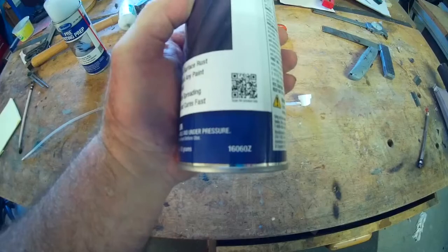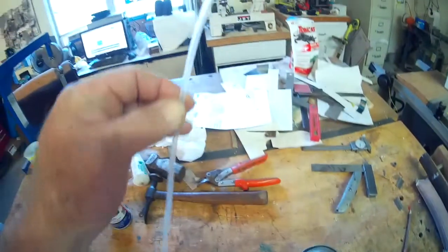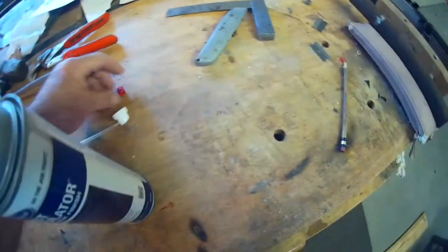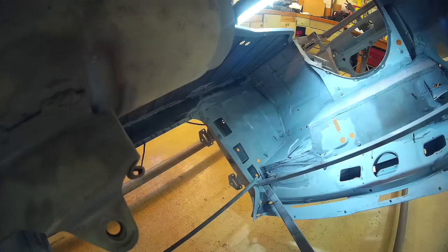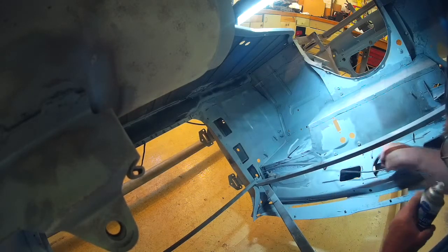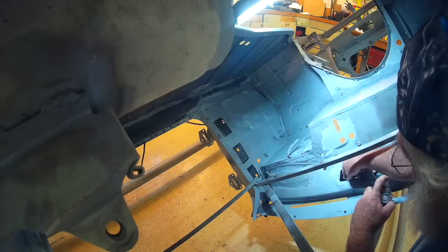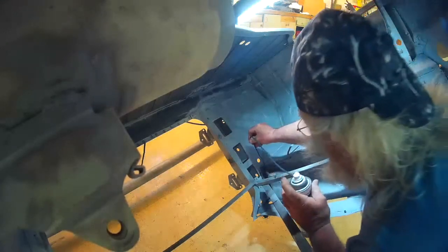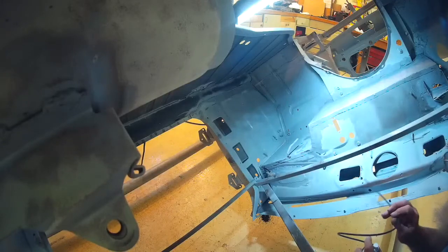This is the encapsulator — I'm trying to focus here on the part number. And this is the nozzle that they sell separately; it comes with the frame internal spray. I had emailed Eastwood and they said the frame material is not paintable, so they recommended this. I said I kind of wanted to use the frame because of the nozzle, and they said you can buy the nozzle separately and use it with this spray. It worked quite well. The spray pattern is very thin — it creeps in all the edges, sets up reasonably quick, and cleanup is with lacquer thinner or acetone.